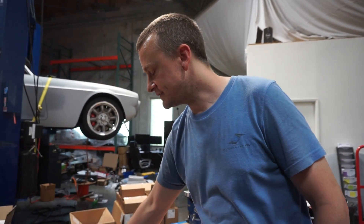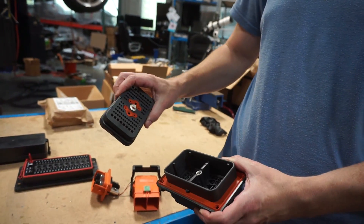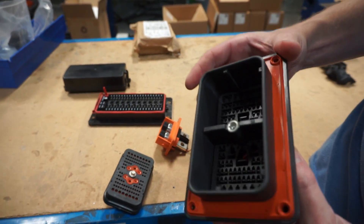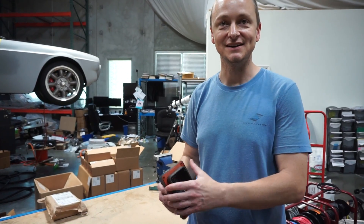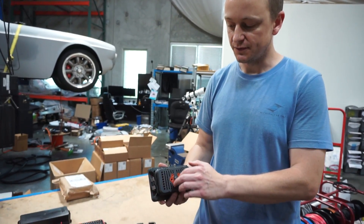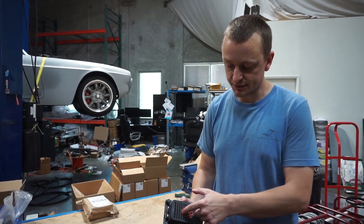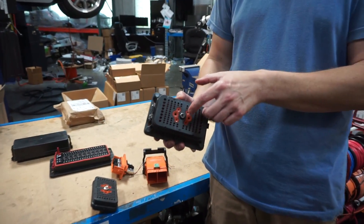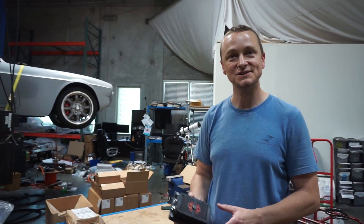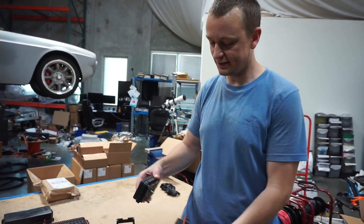The way we're going to get the low voltage into the battery box itself is we're going to use this connector - it's 102 pins and also weather-tight. This is the side we're going to put into the battery box, so we're just going to cut a hole. Normally we try to get this into the waterjet laser file and it just plops in. What's nice about this plug is it has two really beefy pins that we use for our charging plugs for DC high voltage, and battery heater and air conditioning can go on these. It's rated at 600 volts.